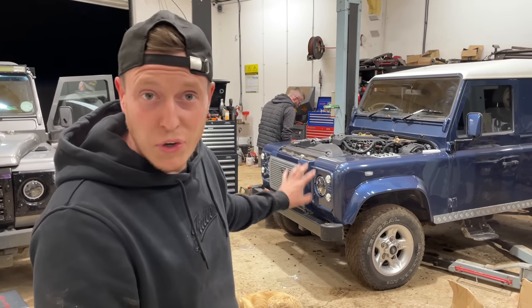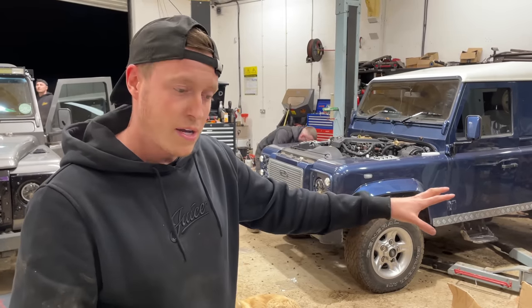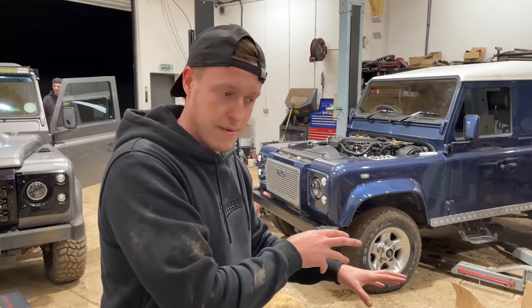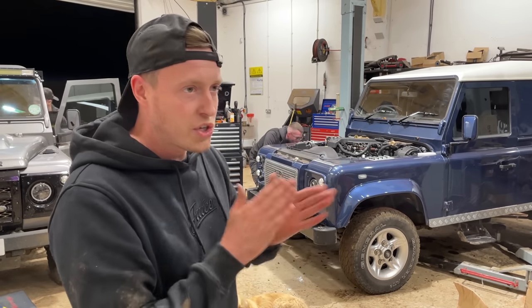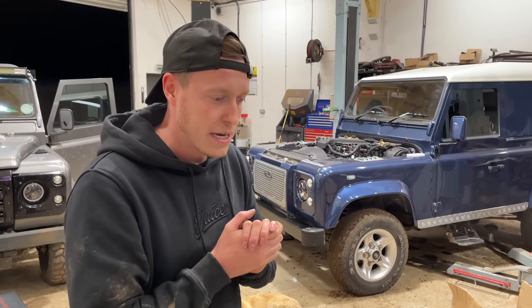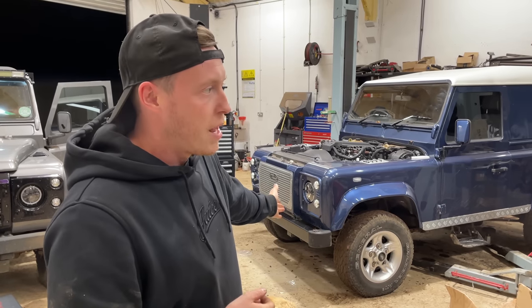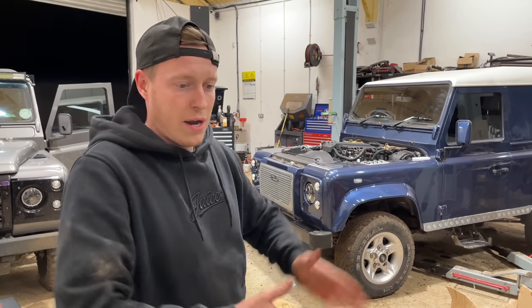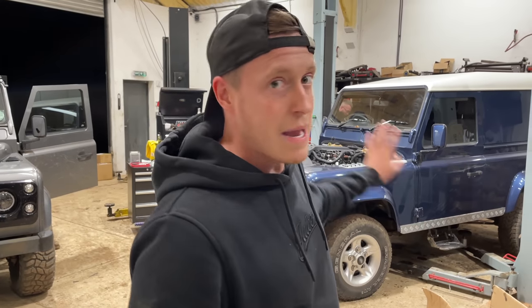Those wheels and tires have got to go, we all know that. And I have gone for the same ratio of tire that I fitted to the Safari 110. I will leave a link in the description below so you guys can check it out. It's a 255/85 R16, as opposed to an initial 235. I don't know what they are, but 255 gives it that taller classic balloon look. They look quite big, and I've had the wheels painted in the same Cairns blue.